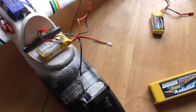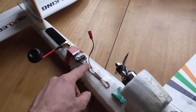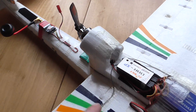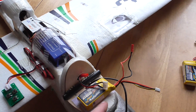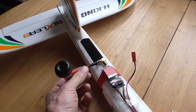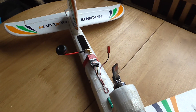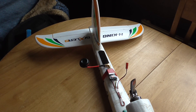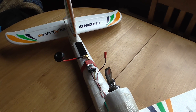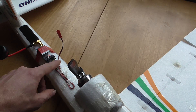That powers the FPV cameras. Now originally I did have a wire running through there, through the spine, up there to the power tree. But this is greedy. I noticed this when I put these thicker aerials on — when I put it at certain revs I start to lose picture. I used to think that was with the ESC, but it's not, it's this.